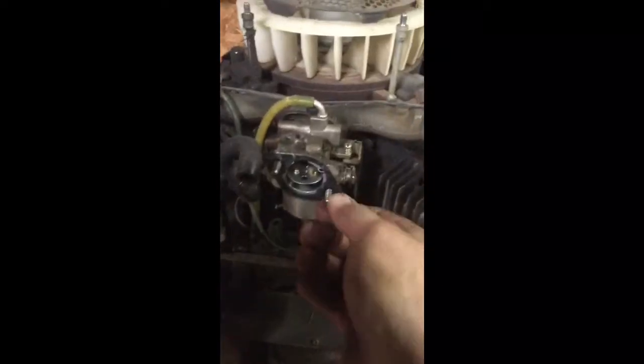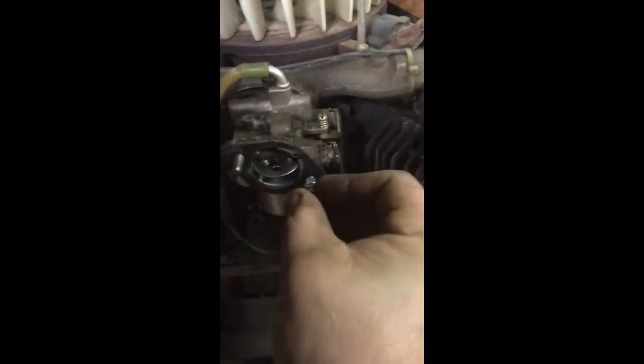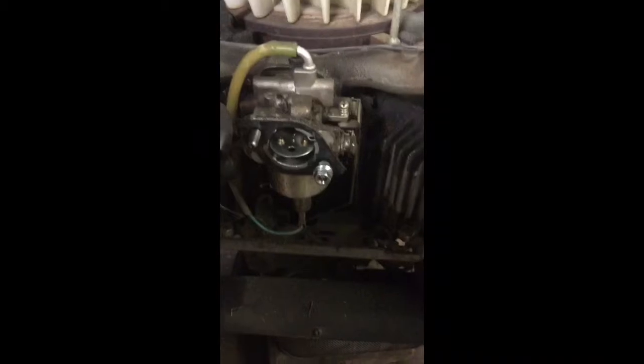And the best thing to do with these studs is you can actually take two nuts, especially the ones that come off the cover. You can put one on backwards here, just like this, and then take another one and put it in the front. And then you're going to lock it down. As you can see, I went ahead and took the studs out of it. All we have to do now is just pull them out. And on this one right here, you can see how I locked it in.